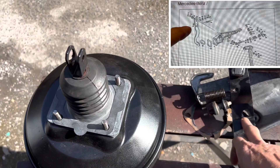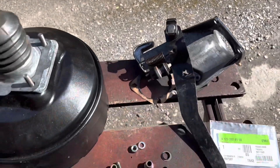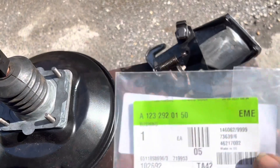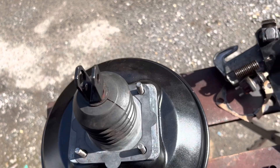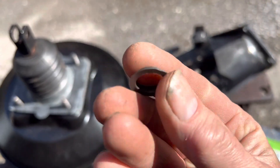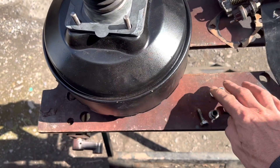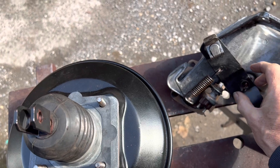The Mercedes diagram is not clear at all when it comes to the fixings of this brake pedal to the brake booster — it depends on the style of brake booster and also on the pedal. On this particular car with the plastic bushing, do not be tempted to think that the bushing you can buy from Mercedes — part number 123-292-0150, which is a metal bushing — is the same as this plastic bushing, because it's not. They're completely different. Similarly on the parts diagram you can also buy another piece which is not necessary for this particular style, so we bought a whole load of bits to clarify it.